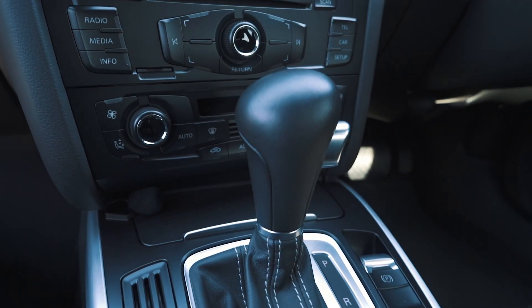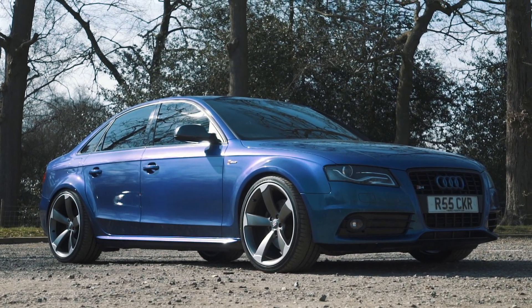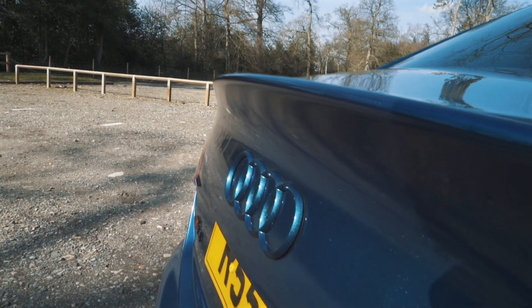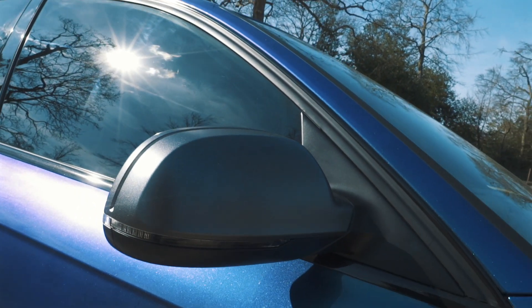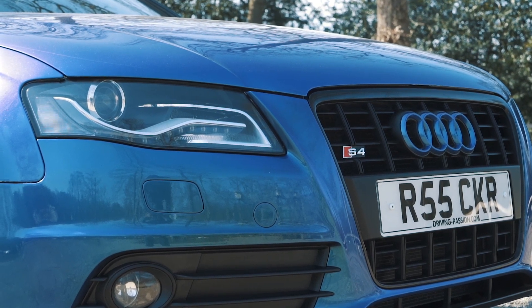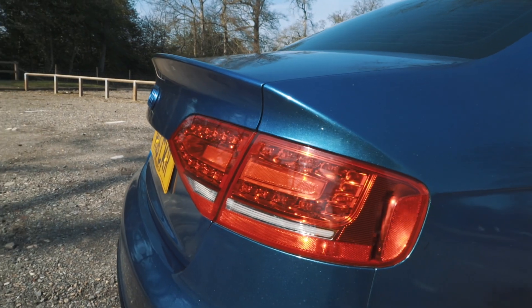DSG box? Yeah, DSG. Anything done to that? Engine and gearbox have been mapped by MRC — there's a few tweaks in there. That's Stage 2 Plus, I think they call it. Yeah, so it's pulley, high-grip belt, air filter mods. It's still got the air box — a K&N cone filter in the air box — because they are prone to a bit of heat soak in these engines. We did a test with MRC: before heat soaking it was 493 PS; after heat soaking it was running like 450. You'd lose about 10% if you haven't got the right cooling. Last time we checked it was running 493 PS.